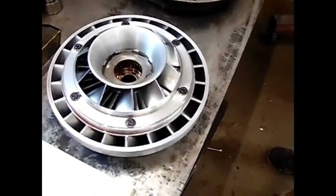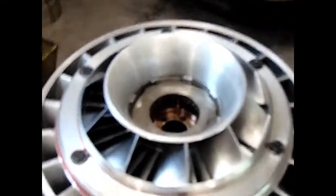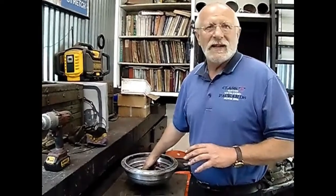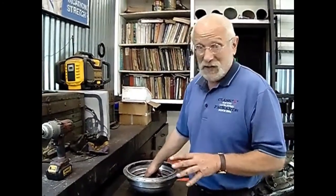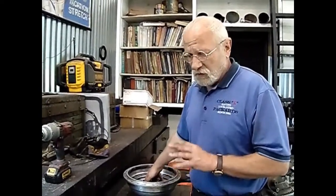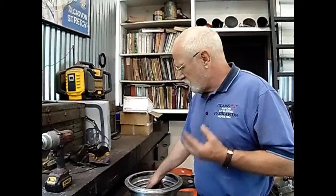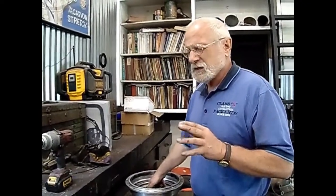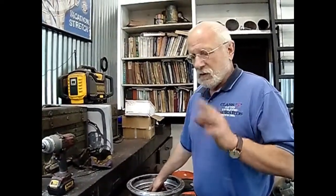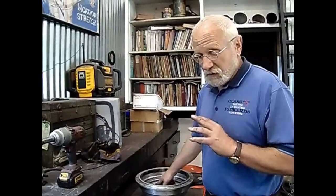That would all be tremendously inefficient because of all the turbulence. So what you have to do is cause the fluid to realign itself to be ready to re-enter these vanes again. This was a huge step forward in the late forties when it was invented — you get smooth fluid flow and actually not only transmit torque, but multiply torque. Being a '56, I think the torque multiplication is something like 2.6 to one, which I think was the highest in the industry. There were reasons why Packard went that direction. It was actually a very good torque converter.